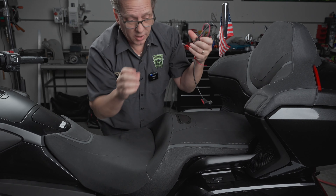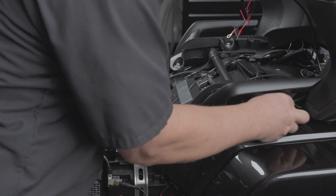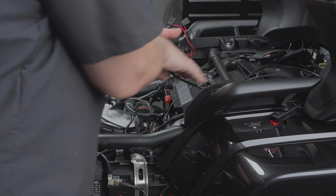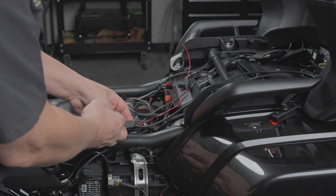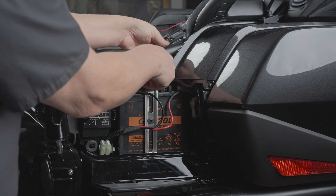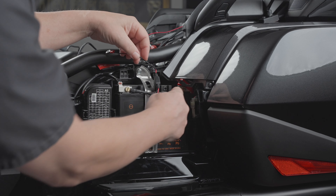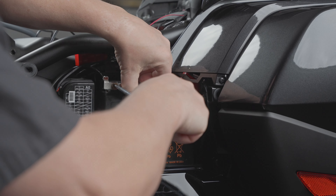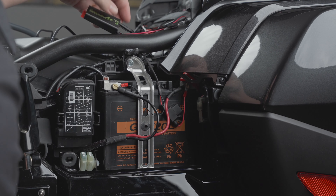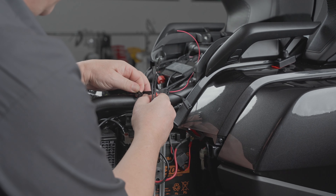Let's get the seat off and get to installing this. We want to locate where everything's going to go. For the manual controller, I'm going to place it here — we'll mount it in that area but do that last. We're going to run the wire back and around here. This controller magic box ends up right in this area. We're going to run these wires right under this bar. Your black wire goes to the ground over here, red wire goes to the positive. Make sure those are nice and tight. Now your power is hooked up and the controller is ready to test the three channels, which I recommend doing right away before going any further.